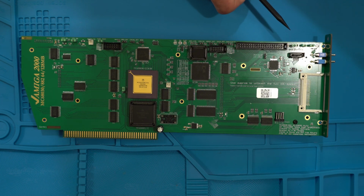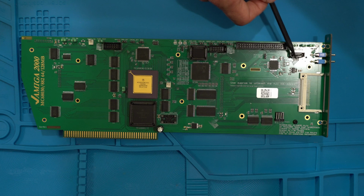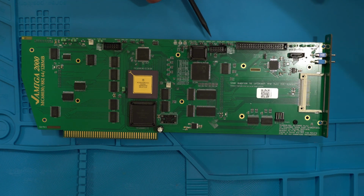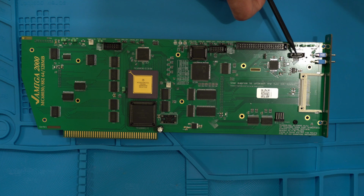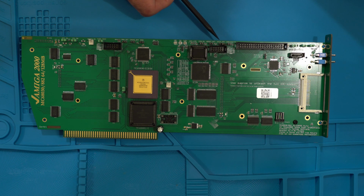And then you have the SATA off, so there is a SATA port here, and there is actually one on the back for an M.2. You can only use one or the other. You either use this or use the M.2 on the back. I'll be using this, but you have to leave it enabled. If you don't have any intention of using these two ports, this port here or the one in the back for the M.2 SATA, you just don't have to worry about such things. You can just turn it off.